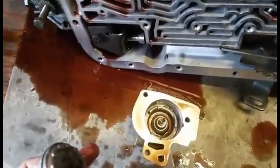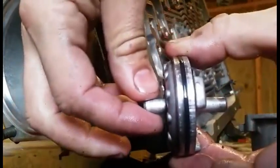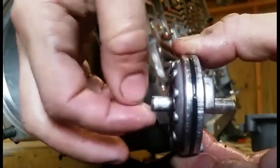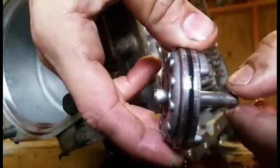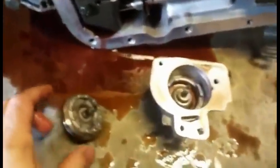I'm going to put the camera down here so you can see this. I'm going to hold the piston with one hand and wiggle the pin — you can see on the right-hand side how that pin is wiggling. It should not move like that, and it does it the other way as well. It gets more extreme the more I pull it out towards the end, which amplifies the effect. That is a good candidate for replacement, otherwise you're going to have shift problems, especially on a 700R4 where the whole thing is hydraulically controlled.